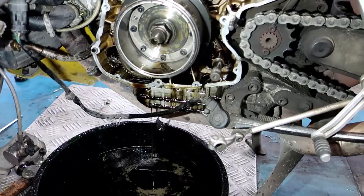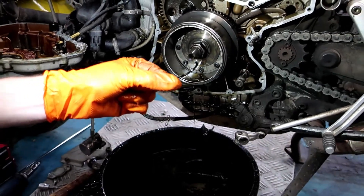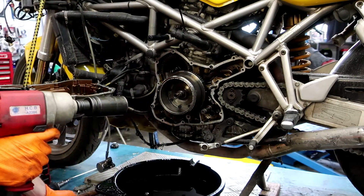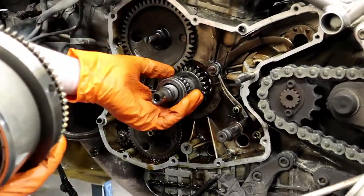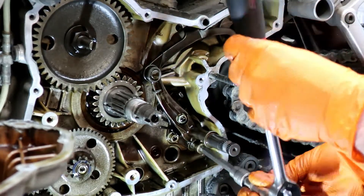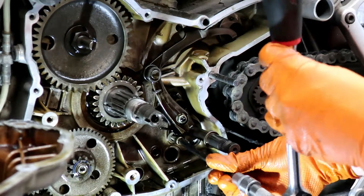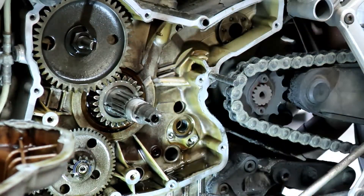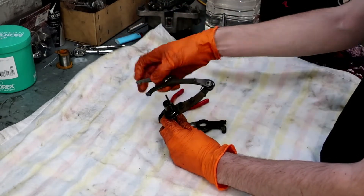Now look what we find here — that is half of the broken spring. We get the alternator rotor off; the whole thing comes off in one piece with the starter clutch and there's a little bearing there. Remove these two little bolts and it pulls out the whole gear selection mechanism, also referred to as a detent. You can see that spring hanging out there — that's the other half of the broken one. It'll be a bit clearer once we get it out on the bench. This secondary plate is only held on with a little clip, and that is where the spring lives.